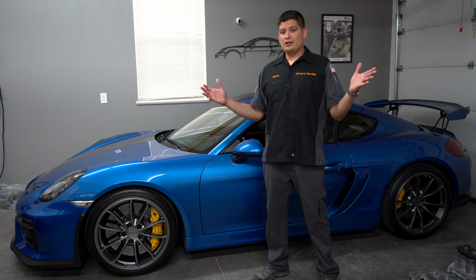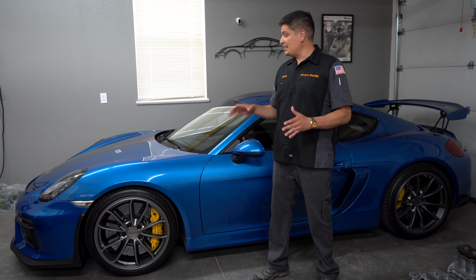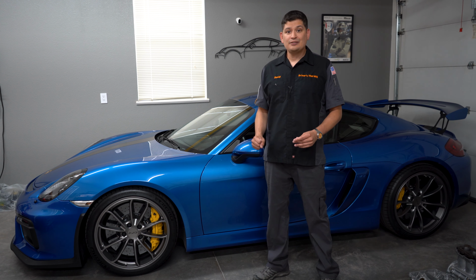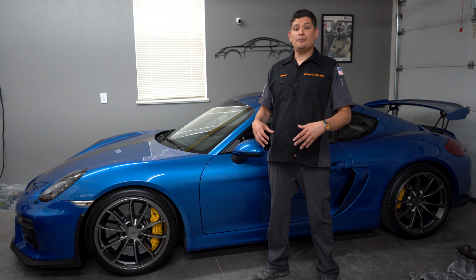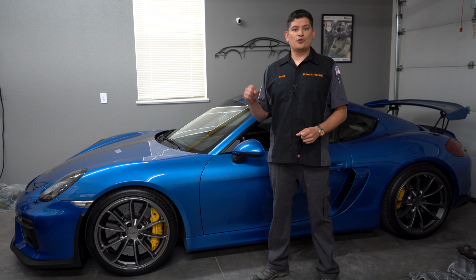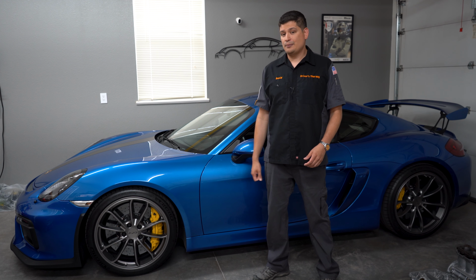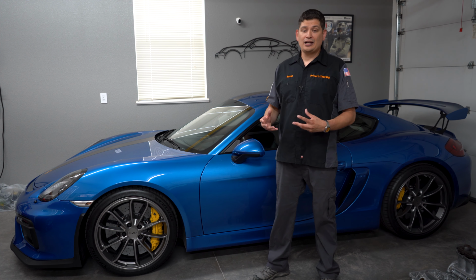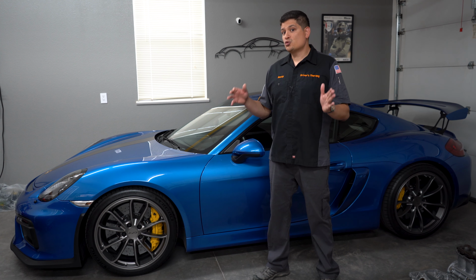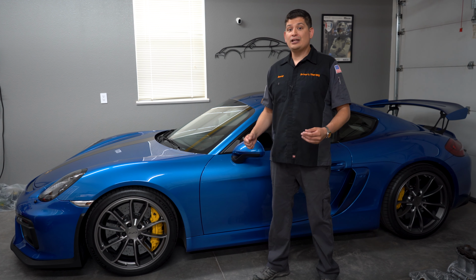Since we're on the topic of liquids, fuel and everything, we're going to talk about fuel and oil and the car itself. Now, if you have a friend or a family member who's out there taking care of your car or driving it, ask them to make sure that they drive it until all the temperatures are up to operating temperatures. Essentially, you want to just go for a good drive. You want to make sure that the coolant gets to the right temperature, the oil gets to the right temperature, and everything's being utilized correctly. The reason why is that if you do short trips, that is not good for the oil, that's not good for the car. You need to really get it warmed up.